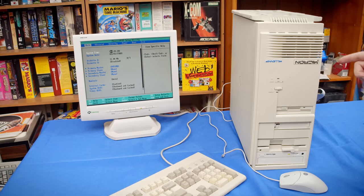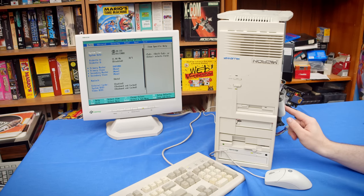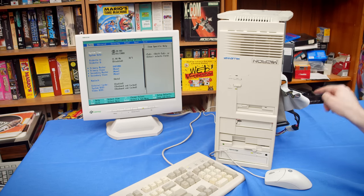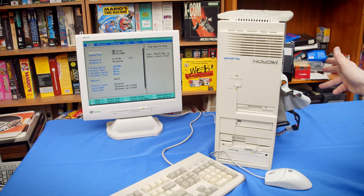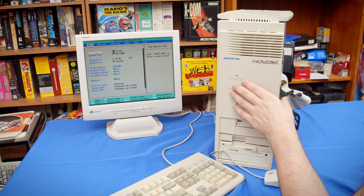That hard drive I picked, which was only 40 gigs and I thought was gonna be pretty safe, may not work in this. So I put that SD card adapter in there, as you can see. That's a 32 gigabyte SD card that I'm suspecting is actually formatted to 32 gigs, and it only shows up as 8 here. I was wrong earlier, this thing is from 1996. It's possible that it really can't handle anything more than 8. Seems a little weird though, but maybe, I don't know. I don't really care that much.